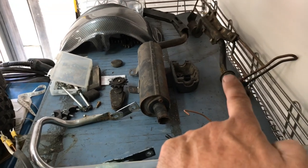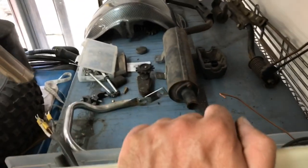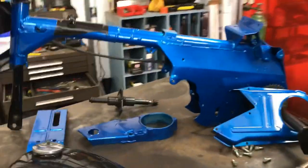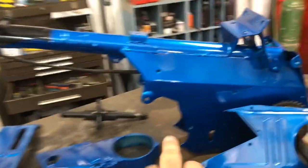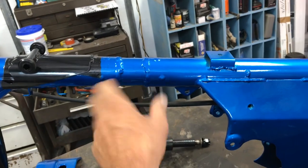Still got to clean the exhaust up and paint it, still do the powder coat on the foot pegs and the front new fender — kind of a grayish black composite look. Got the hardware, one of the tires, new seat, and new rear fenders down here. That's going to be a fun little project when I start throwing that together. I should have filmed pulling it all apart and getting it cleaned up, but I didn't. Parts are back from powder coat. One little note: if you guys ever do one of these builds and want to put a bigger motor in than the Honda 70, you need a little bit more clearance.